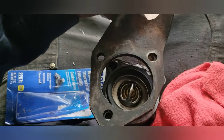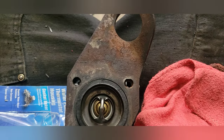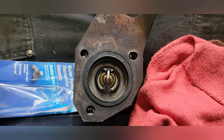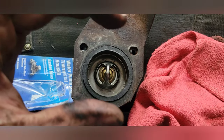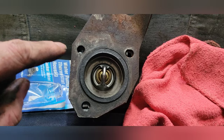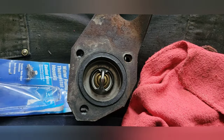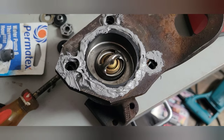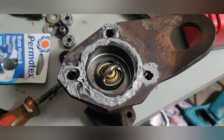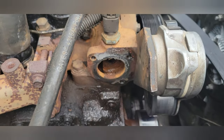Slide that down until all the holes are lined up. I gave it a slight wiggle to get that RTV worked around. Now I'm putting some more RTV out and around this part — running it all the way around and around the bolt holes. Now let's go put it back on the truck. Don't forget to get the mating surface nice and cleaned up too.